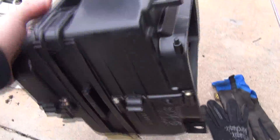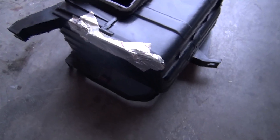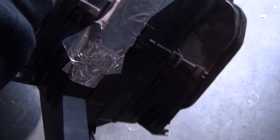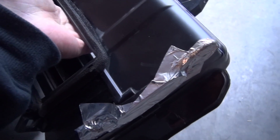There are some holes you have to tape up with aluminum tape — this one and that one need to be taped, and there's a small hole down here which is the drain line. I wanted to show the foiled AC unit — foiled there and foiled there. I decided not to foil the last one since it acts like a drip for condensation. On the inside I foiled the holes as well, inside and outside, so that should be good. You can get this foil tape at Lowe's in the air ducts and ducting department.